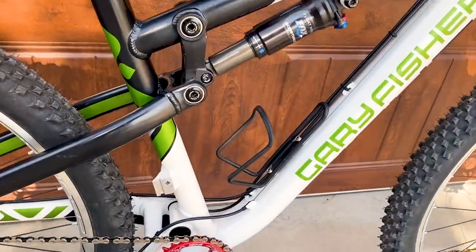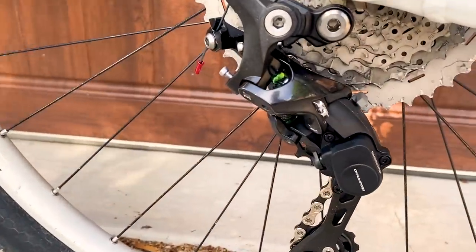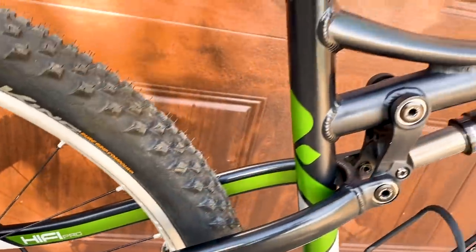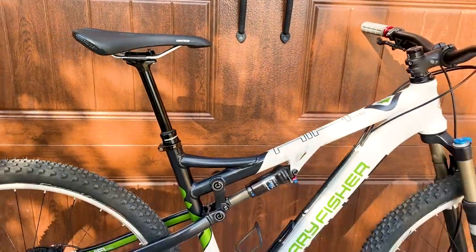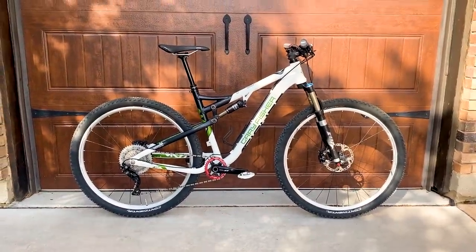So if you've got an older 29er, older meaning like 2010, which to me doesn't seem too long ago, a lot of those earlier 29ers had those steeper head angles because the geometry changes with the 29er hadn't come yet. It could be a great option for an angle headset like I did on this bike. It really updated and made it awesome.